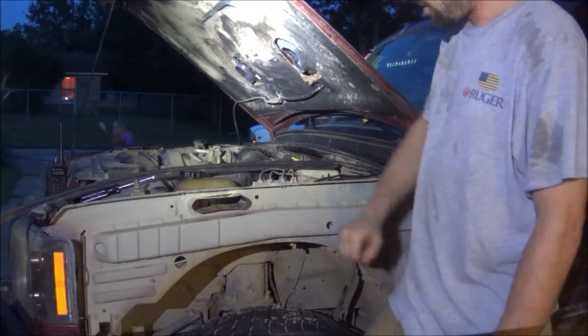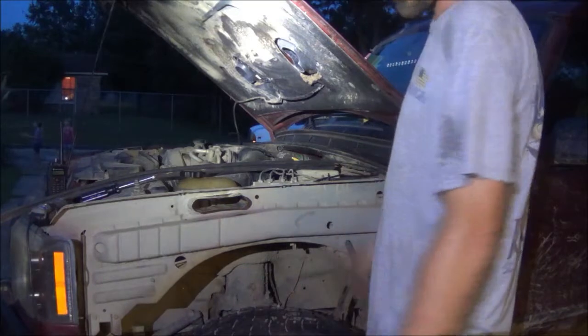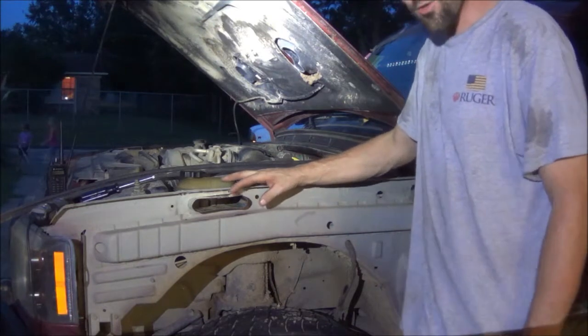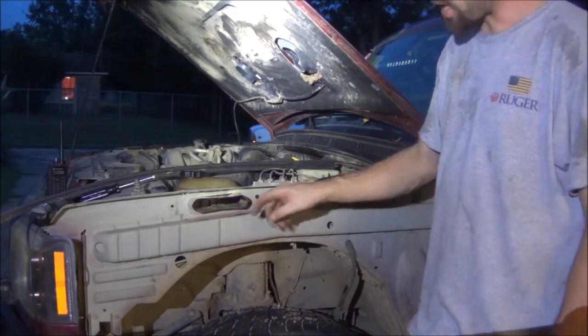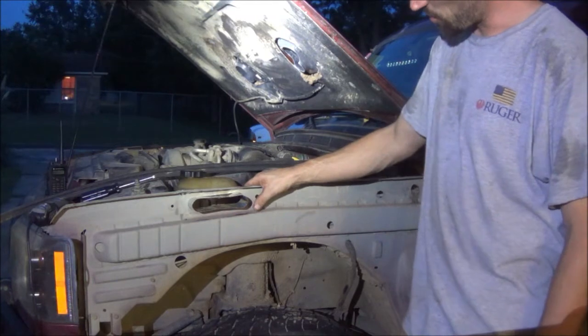So first step, you've got to pull the fender off. It's just a matter of pulling a couple bolts off and pulling the fender off, pretty easy. Follow your Rave manual to get to here. This is a piece of 4-inch dryer pipe or heat pipe, whatever, and I put it in the vise. I put it around a 21mm socket and just kind of rounded it nice so it didn't kink, and it fits in here real good.